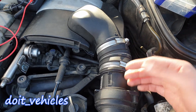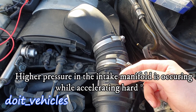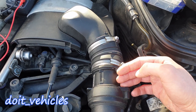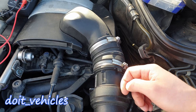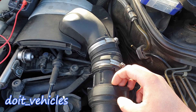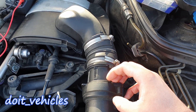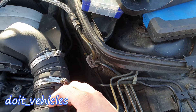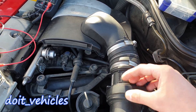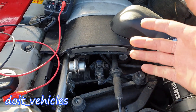To make things clearer: if there's a crack in the intake manifold, the pressure inside it will be lower than expected. The PCM sees a lot of air going in via the throttle body but not much pressure increase inside the manifold. It might assume the car has climbed to a high altitude like 5000 meters, where ambient pressure is lower. When the altitude sensor confirms that atmospheric pressure has not changed, the PCM can throw the most accurate trouble code for the cracked intake manifold.